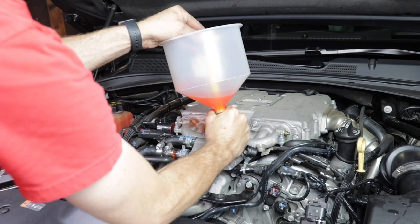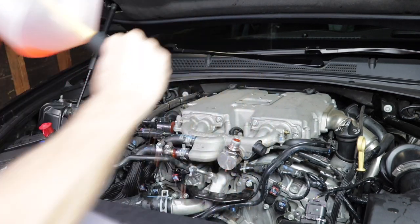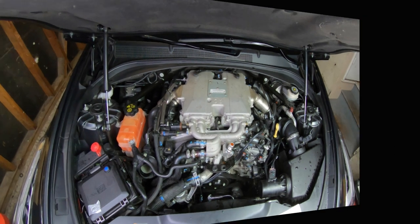When you're all done, put the funnel plug in and remove the funnel from the Schrader valve. There will be some spillage — be sure to wipe it up and rinse it off. That's it for bleeding your intercooling system. It's not too bad, really. I do suggest you go back and bleed it occasionally to ensure that it's operating at its max performance.